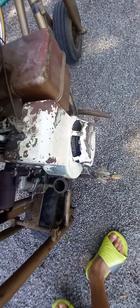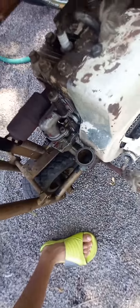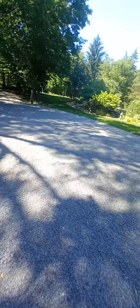I think it's a Briggs and Stratton — a Briggs and Stratton 3-horsepower engine, very old. We have to put an air filter on it because that's probably one of the reasons it's not working right. We don't have an air filter on there and it likely sucked in a bunch of dust. We had a storm the other day that knocked down trees, people were cutting them up and probably put a bunch of sawdust in the air. That thing probably sucked up most of it, and that's one of the factors it's not working.